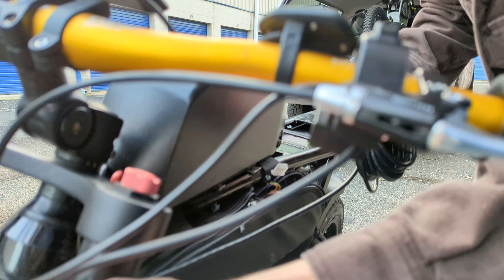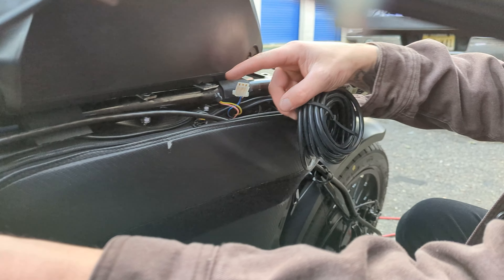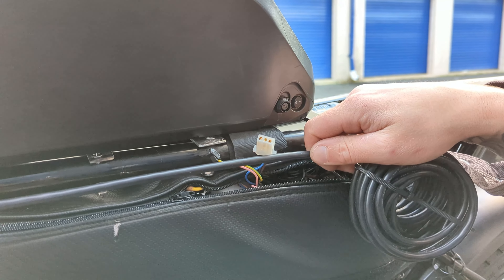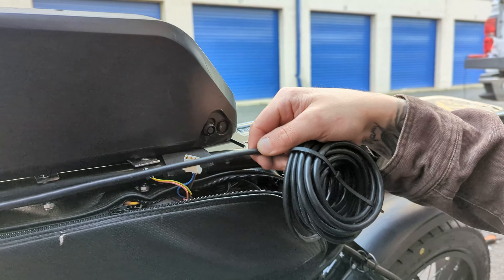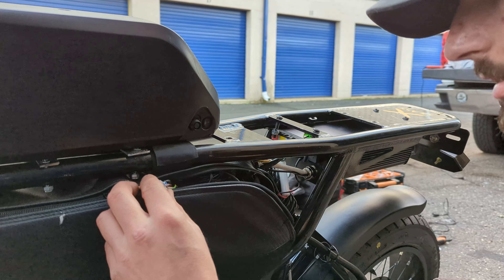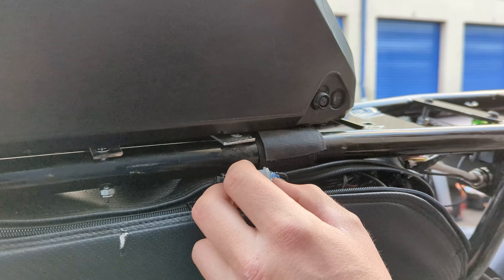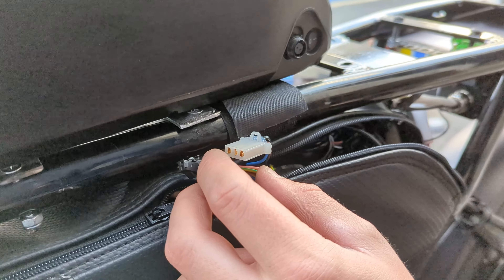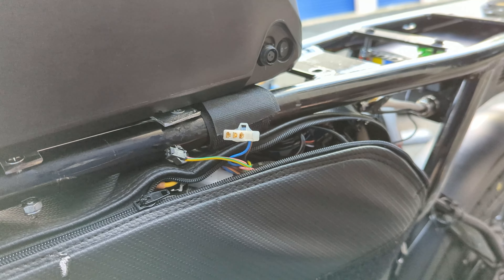The light is going to be right here, and this connector is for our headlight, so I'll make the wire long enough to reach there — maybe a little longer for some play. You can see on the harness there are three wires: brown is positive, black is negative, and blue is the high beam. We'll figure out what lights are what once I put the extension on.